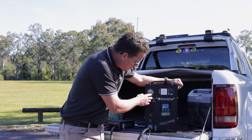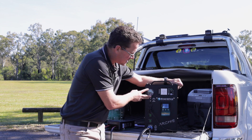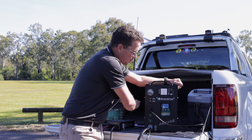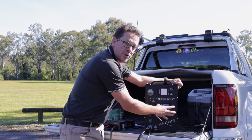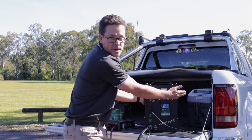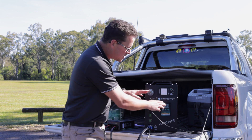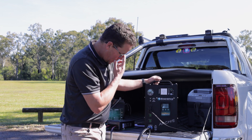A common question is whether with an AC charger or DC to DC, the current shown may not match up with an e-pro or other meter. The reason is simple: the charger is outputting charge going into the battery, but if the fridge is cycling on, it's supplying power to the fridge as well as the battery. The e-pro plus meter only shows power going into the battery, whereas the charger shows the full current from the charging source going to the battery or any loads. If you've got everything isolated and aren't pulling any current, those values should line up closely.